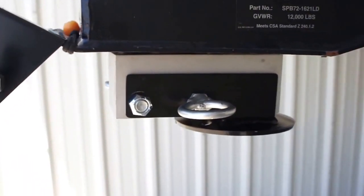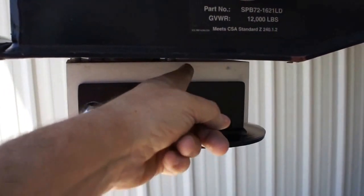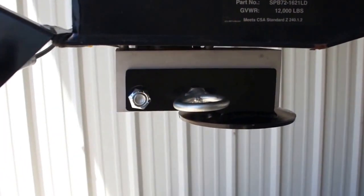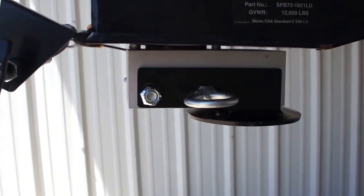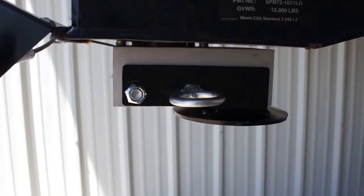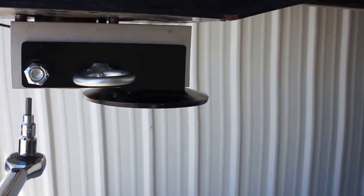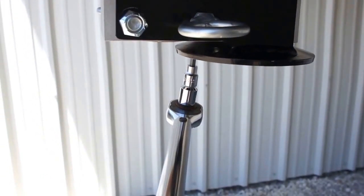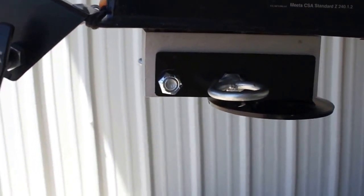Tighten the bolts. Once that's tightened, I measured the back from here to the edge to get it centered. So measuring off front and back, it's 4 1/4 inches for me on each side. So it's perfectly centered. Once that was done, I tightened the 4 hex nuts. There's one here, then there's a hole in the funnel plate so you can get to the back too. So I tightened them in a star pattern and got those all tightened. And once they're tightened, this won't move.